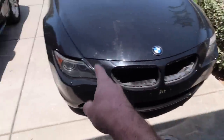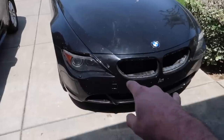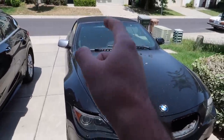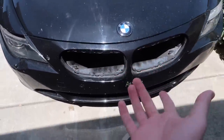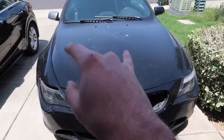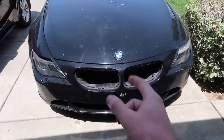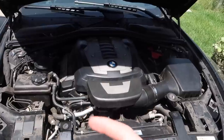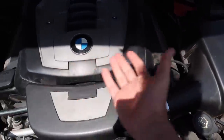I'm still waiting for the turn signal — I ordered that one and I still can't find anyone selling it for a decent price. We got some bulbs that came in and we also have the PCV valve. We have all the mods in the trunk for this car. We're going to replace both PCV valves. It's also leaking coolant all of a sudden, so I don't know what's going on with that — maybe the radiator is cracked. Let's go ahead and put in the new PCV valves. Hopefully the idle will go back to normal, hopefully no smoke, and at the same time put in some coolant. We're gonna need to remove this guy and that one, and once you remove these two we can go and replace both PCV valves.